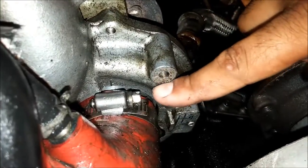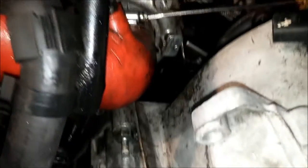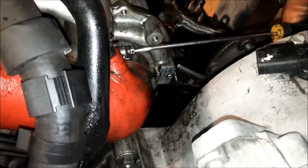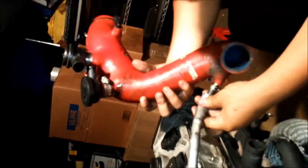The discharge pipe is completely removed. The next thing is the turbo inlet pipe — that one is also held together with a phillips clamp down at the bottom. Get that unclamped. This is all being done with two guys on our days off from full-time jobs, and we want people to understand this can be done pretty quickly as long as you take your time and do things right. Turbo inlet pipe is now removed.